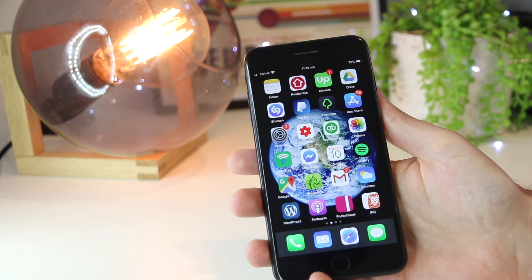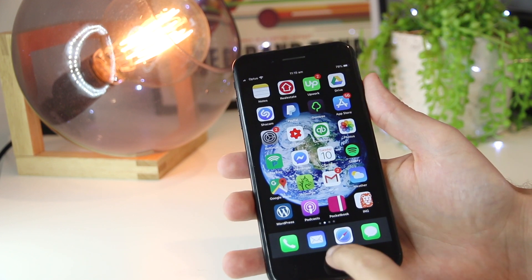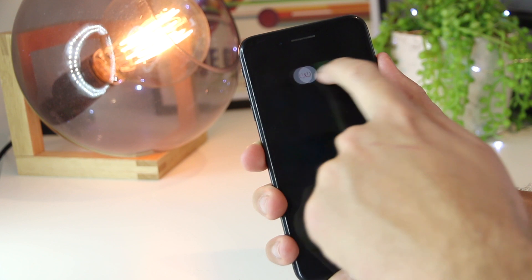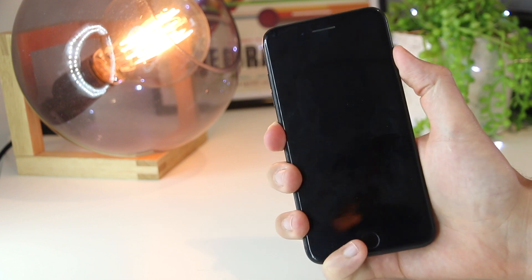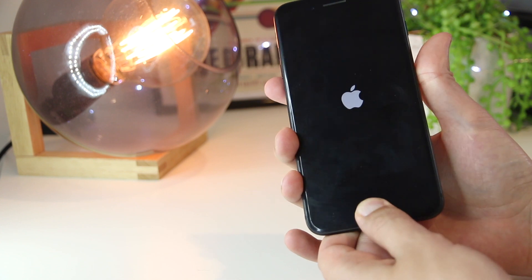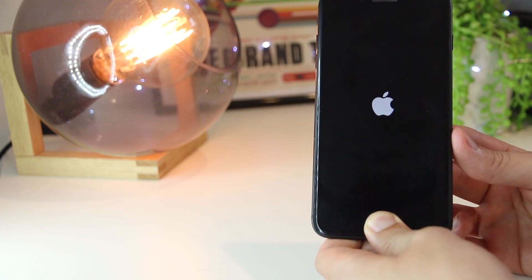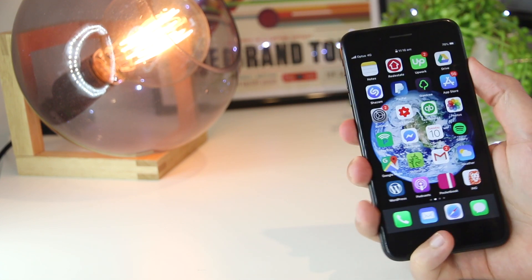As an add-on for this fix, I've found it's really good to go ahead and turn your device off, and when you turn it on, press the home button. So I'm going to power down my device and turn it off. Then I'm going to power on my iPhone by holding the lock screen button, and while doing this, I'll press my finger on the home button until it restarts. And now I'm going to open my phone. Hopefully once you've done that, your Touch ID will now be working.